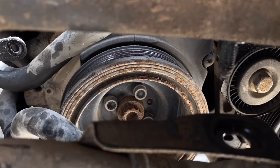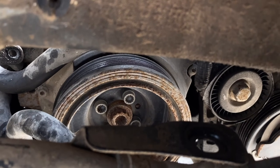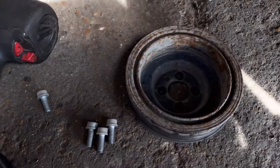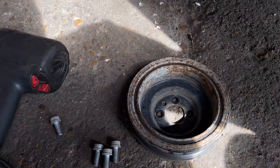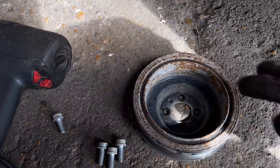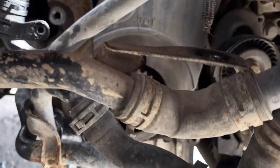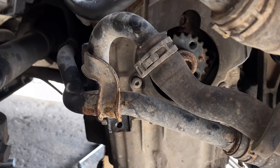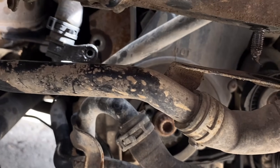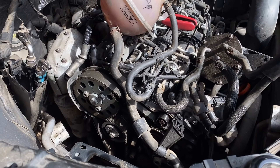Now we need to undo those spline bolts on the bottom pulley — you don't need to undo the big center nut. Undo the multi-spline bolts and pull the bottom pulley off. Remember, don't undo that big one in the middle. Bottom pulley off — four bolts. I did use an impact gun; you can do it with a ratchet but it can end up turning the engine over. Notice there is one locator — you must locate that when it goes back together. Now the bottom engine cover uses T27s, not T25s — get those off and get the bottom cover off.